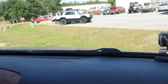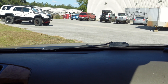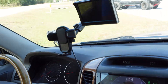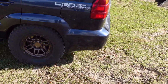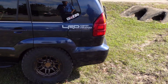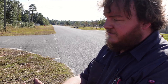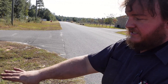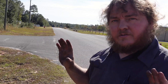Let's go do some flexing — go straight to keep the tires level. Now, have we checked the clearance on the driveshaft? We're hearing the splash guards. She is stuffed up on the splash guard. We can pull out probably another half inch on the lower links to pull it forward. Whenever you have compression of an axle with a fixed point, it has a base circle effect and arcs — so the more it compresses, the further it moves to the rear. Before, with those adjustable links, this is a starting point. Now we know we can pull them forward a little bit so they're not too far forward when drooped, but not too far rearward when compressed as you see here.